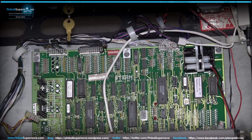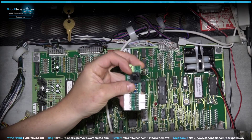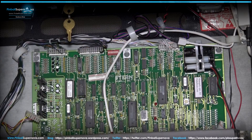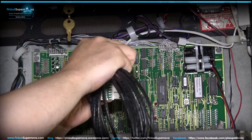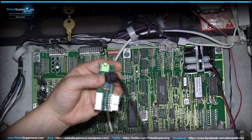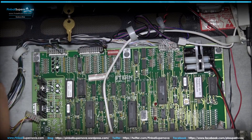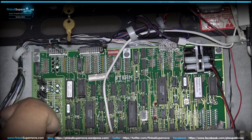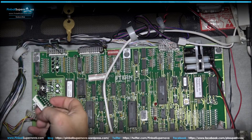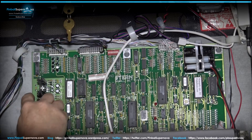Then you take the board that comes with the kit, which has an RJ45 network cable connector in it. Take your patch cable and plug it in first until you hear it snap. Then take the female side — with the holes — and note it's notched: the third notch down from the top has no pin, same with this connector. Then plug it in that way.